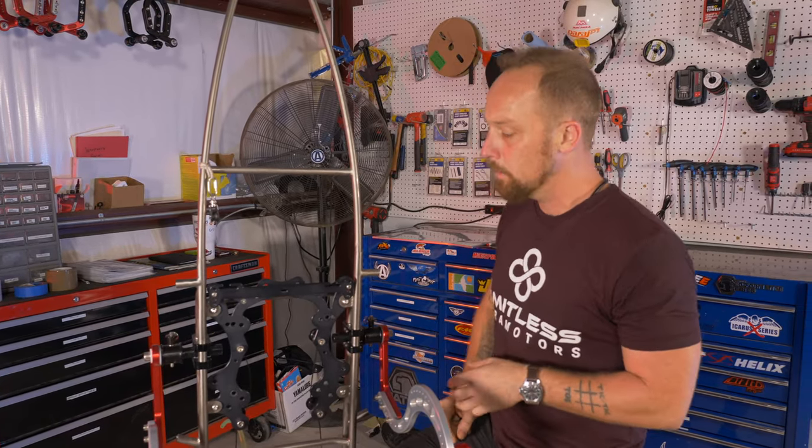The way I'm gonna set this paramotor up is with a little bit of torque compensation offset, and I'm gonna bring the total control up, and what that'll do is bring the carabiners and the swing arms up a bit more above the thrust center line, and that'll change the launch characteristics. It'll keep it from going forward as much. It gets that a little bit more under control, slows that down a little bit.